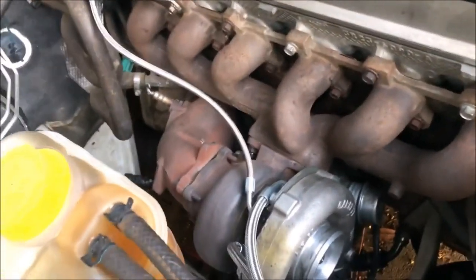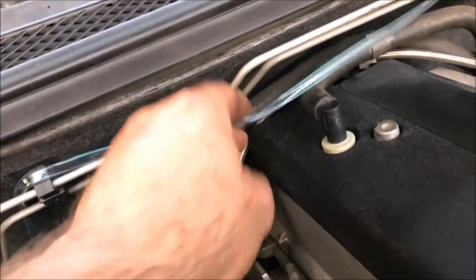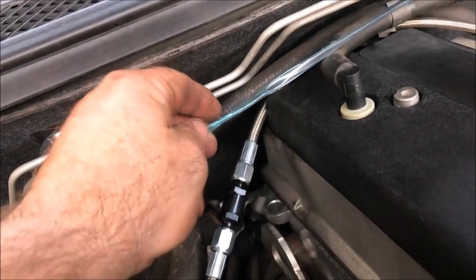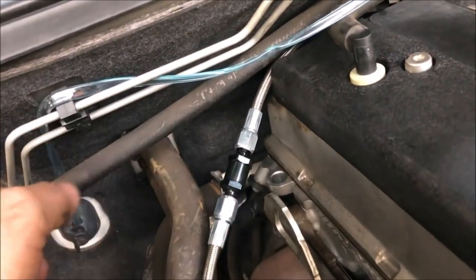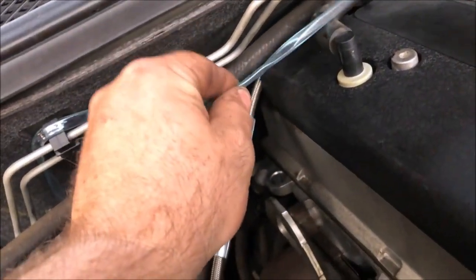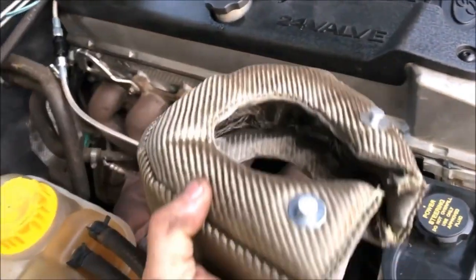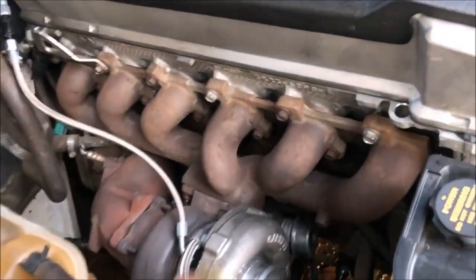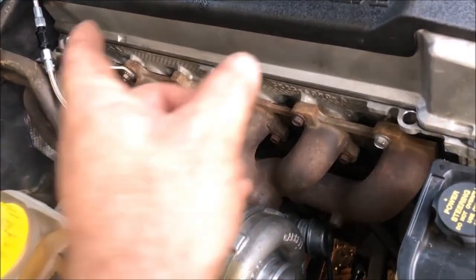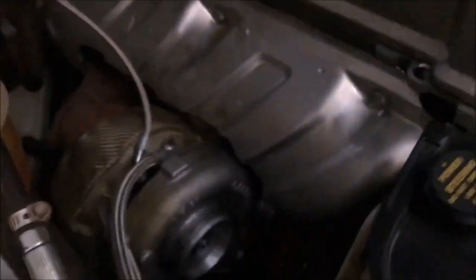That's all back together. The next job while I'm up here is to put some heat shields on — it does get hot under here. That vacuum hose I put in started reading negative nine — it got hot and with the vacuum it sucked it shut. I'm going to replace that with some better vacuum hose. I also bought a turbo cover made of some magic volcanic substance, and I will modify that heat shield I was talking about at the start of the video and stick that back on.